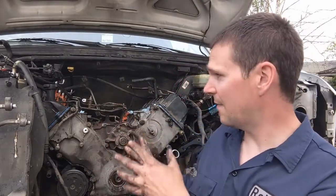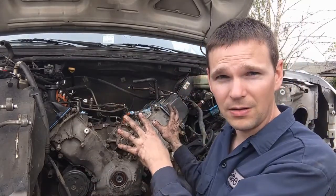Putting the heads on and getting everything prepped was just one other day, so far we've invested two days into this work. The heads had to be done which did take time. If you want it done sooner, you can buy remanufactured heads — buy them ahead of time. For these heads, the pair cost the same as one remanufactured head at the machine shop. So if you want speed and convenience, have the remanufactured heads on hand before you even start — then it's just teardown and put back up, no waiting in between.